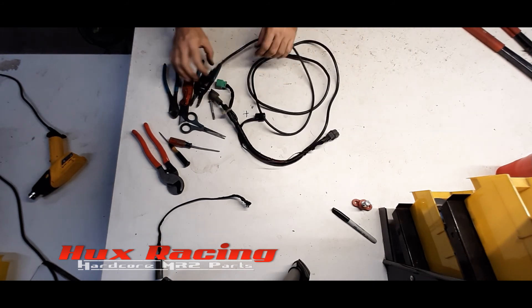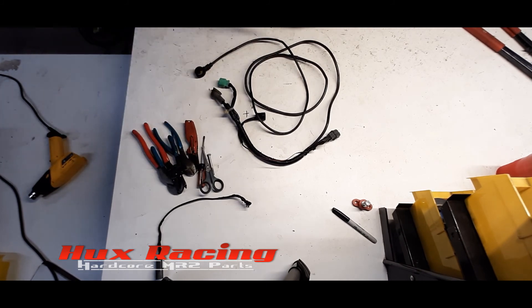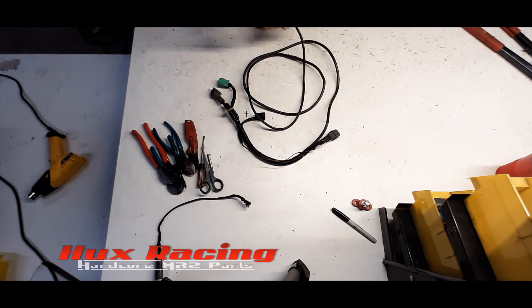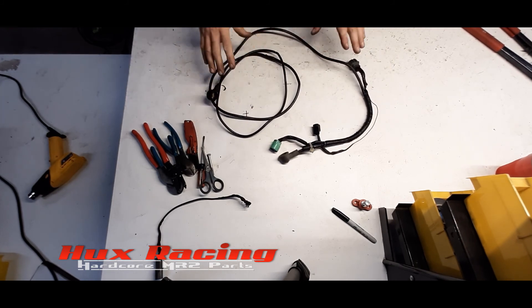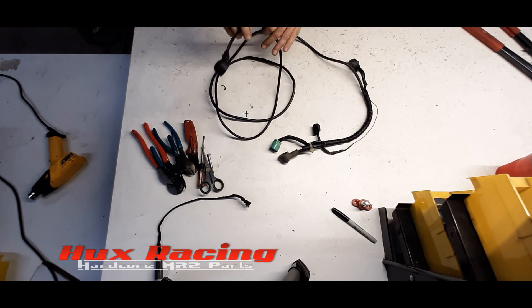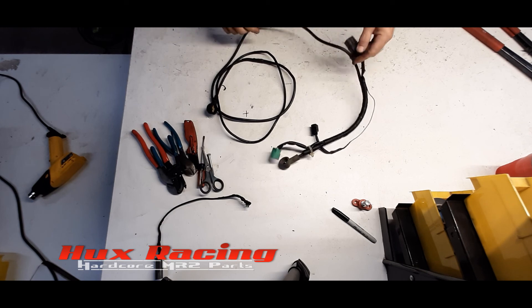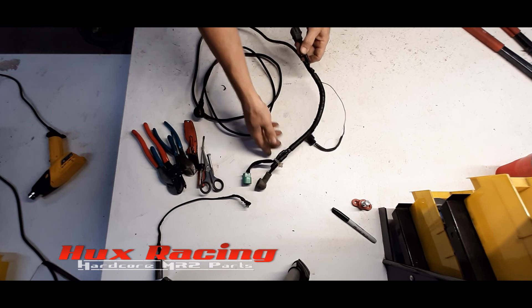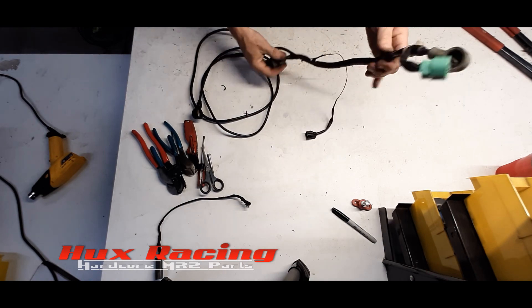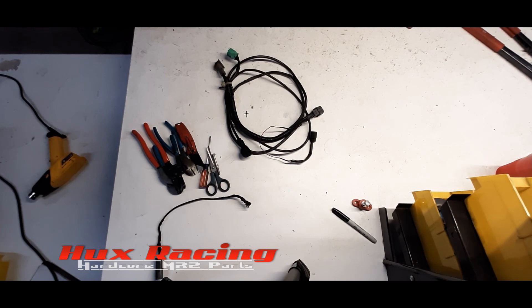So that's really it for preparing the charge harness. In the next video I'm going to show you how to prepare the engine harness section. You can either loom this whole alternator cable piece into the engine harness piece itself so the junction runs up towards where the ECU is, or you can just set all this on top. This connector here should be a matching connector to what you have on your engine harness, and then your charge harness section will all just be plug and play. I hope that helps. This was Eric at Hux Racing.